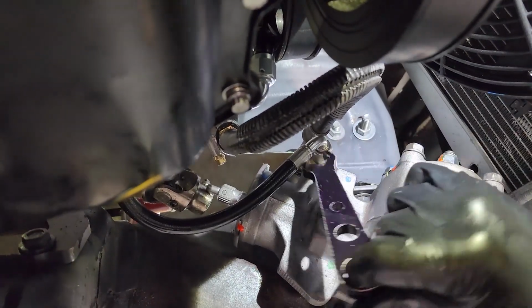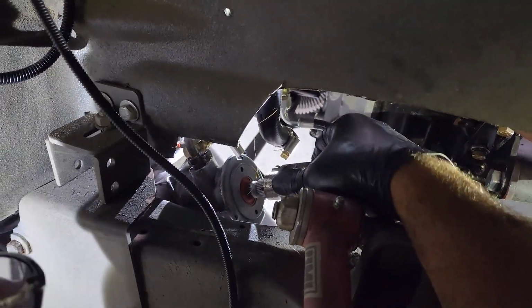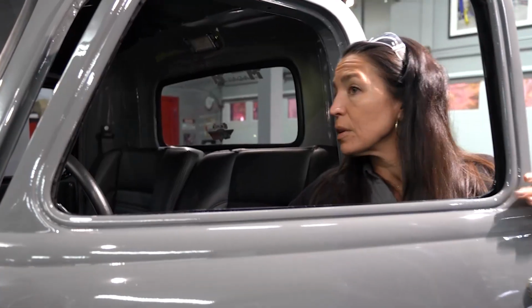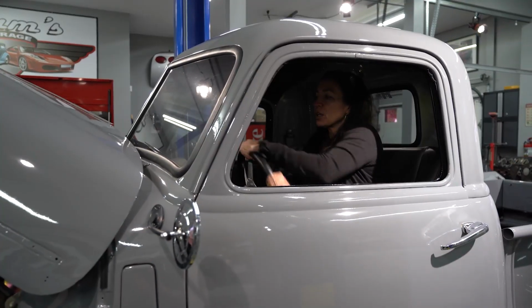And before I put in my steering column, I just wanna confirm this job. Don't go to another job without finishing one job. We're gonna put fluid in there, then you're gonna go in and turn the wheel. And what she's gonna do by turning the wheel is prime the system.